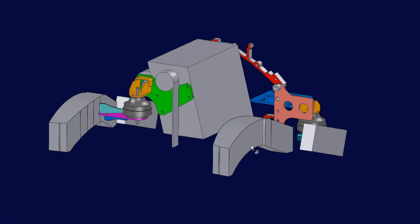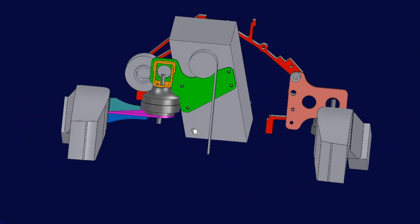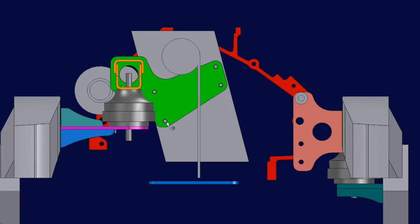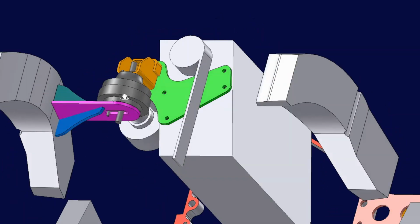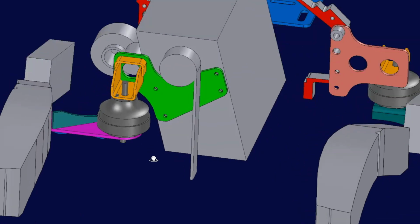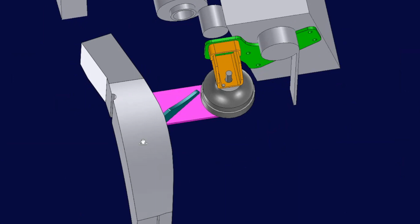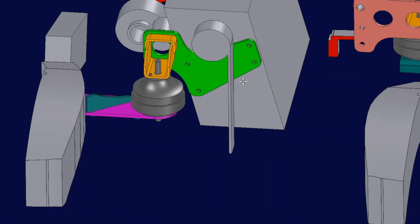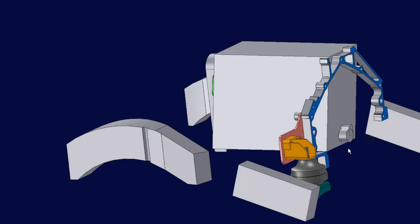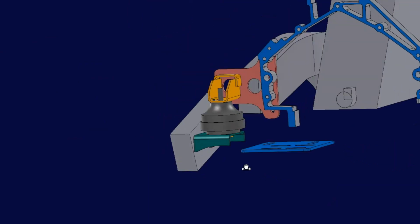Now, in our CAD system, this is basically what we came up with for our motor mounts. Now, the Volkswagen didn't have enough space on the driver's side to be able to make a motor mount because of all the accessories that were on that side. So we initially were going to make motor mounts on the side, but decided that we were going to use the Volkswagen style motor mounts like it was mounted into a Jetta or Passat or whatever car it originally came out of. So that motor has a front motor mount like you can see here, and a rear motor mount like you can see here that we're actually just going to mount to our bell housing.